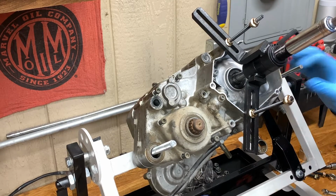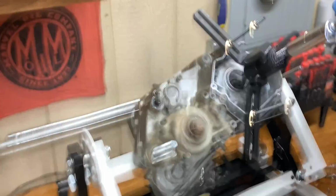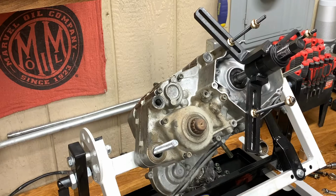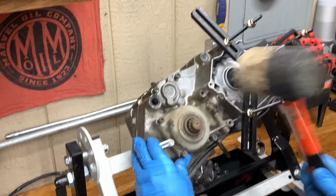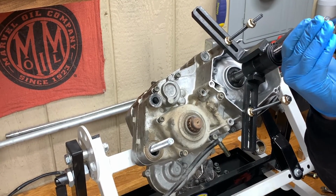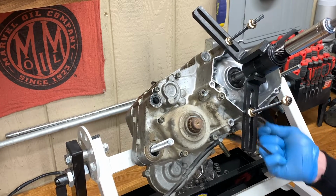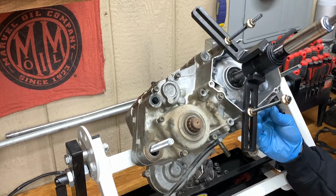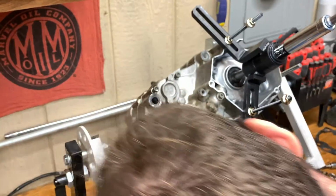Make sure all of our bolts are out here. Let's just verify. Make sure we're not going to break anything. There we go. It's coming apart on that side. Just want to verify it is on this side as well. If not, you could always give this drive a little whack. It should come out. Beautiful. Make sure it's all coming apart. Stupid base gasket's being a dick. Verify both sides. Coming apart.